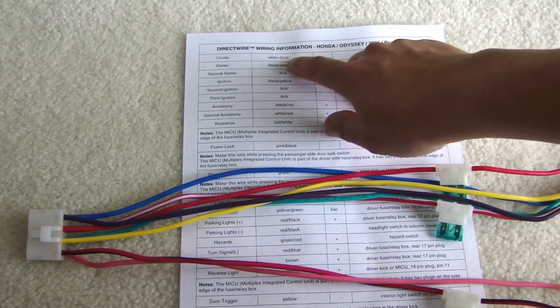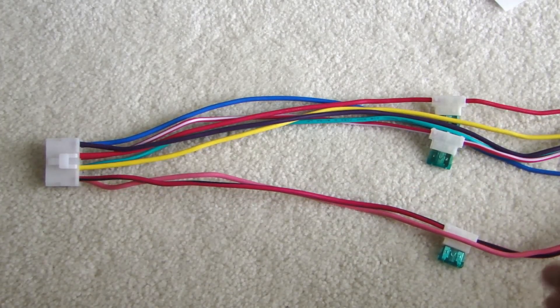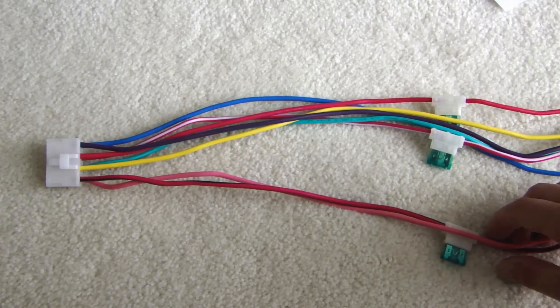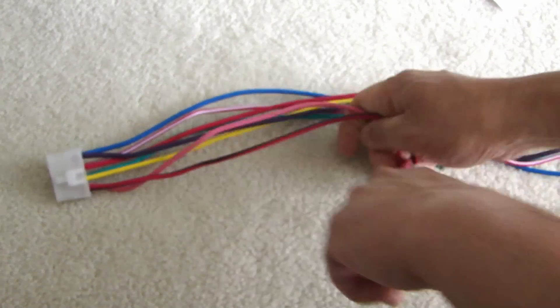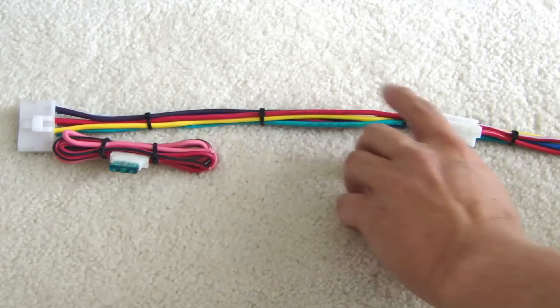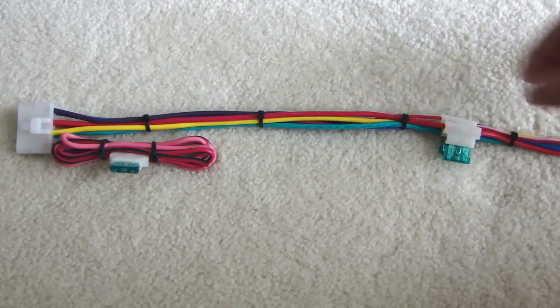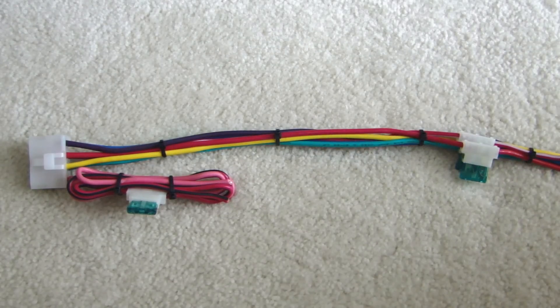For my vehicle these are the wires I'll need for all the ones listed, and these two are the wires I don't need. With these two wires that I don't need, I do not cut them off and I don't recommend cutting them off. Either in the future you might want to use this system in a different vehicle and end up needing that wire, or you might find out as you're installing that you actually do need that wire and were mistaken when looking at the diagram. So what I would do is basically bundle this up so it will be out of the way. Here you see I've put a couple of tie wraps.